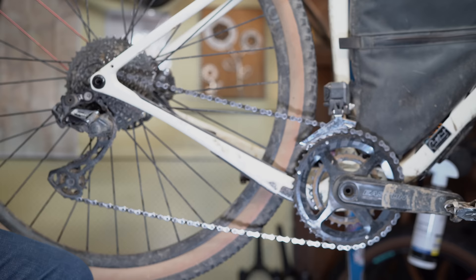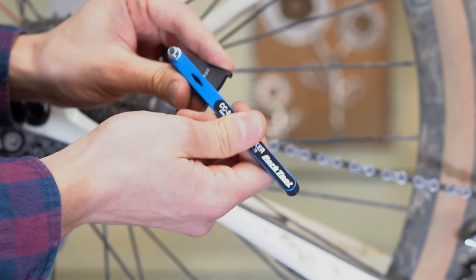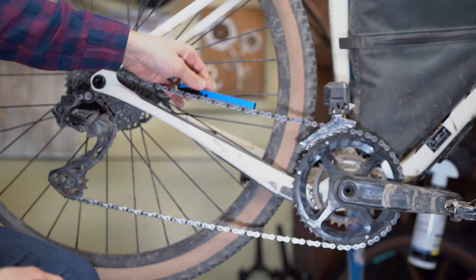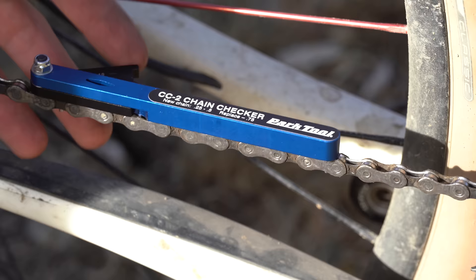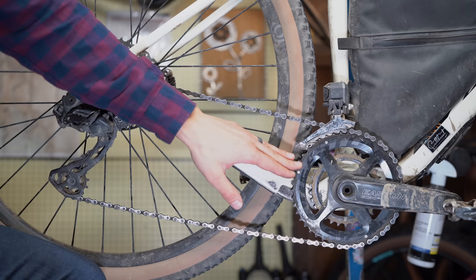So let's take the CC-2. The way this tool works is you move it down until you feel resistance, and that shows you how much the chain is actually worn. Moved it all the way down and there's zero resistance with even more play. So this chain is toasted — it's over 1% worn. Typically you want to replace a chain at 0.5 or 0.75% wear. This leads me to believe that more than likely the chain rings up front are in rough shape and of course the cassette in the rear. But let's take a look at the chain rings first.